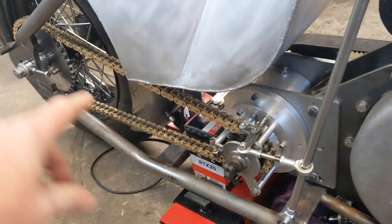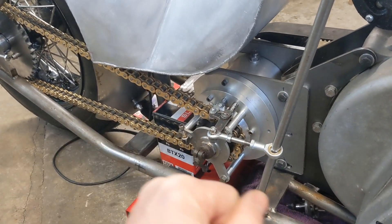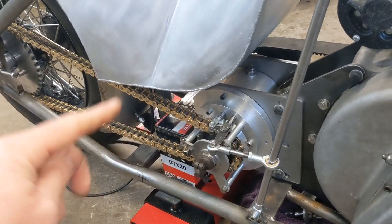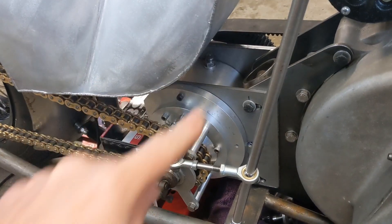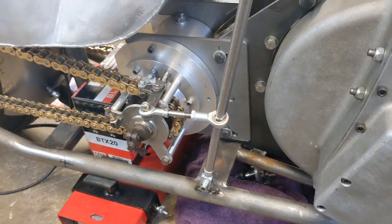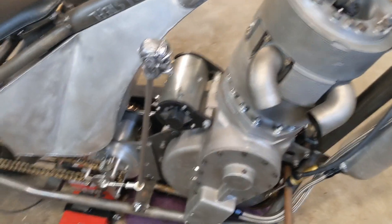When I'm in gear, as well as the detent on the gearbox, the gate will also help it positively click into first, second, and neutral. Interestingly, if you move the back tire it moves the dogs out of line and you can feel it going into gear and out of gear — it won't go into gear if the dogs aren't lined up. There are only one or two positions where both sides line up simultaneously so you can go from one gear to the other — it should be interesting to ride! Thanks for watching, more updates will follow.